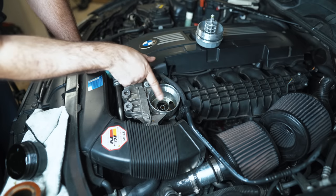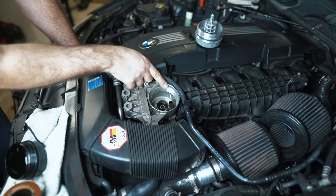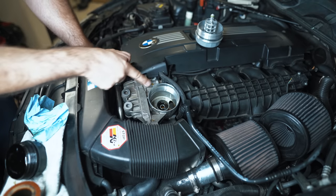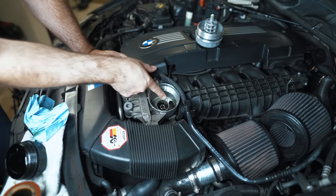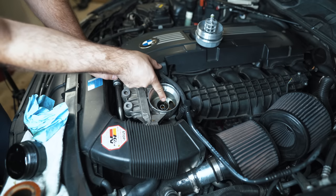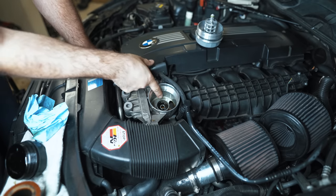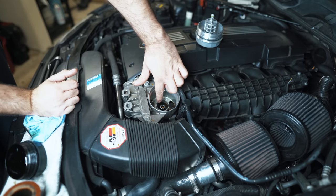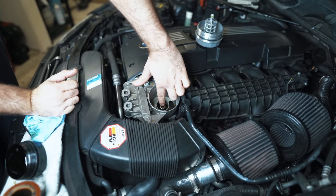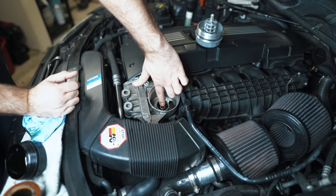If you don't have the cage, you lose the pressure relief, so you can overpressurize your filter at times. But that's not super likely depending on the clearances of your engine. I think it's a volume issue more than anything, because the oil filter housing has a small hole to allow the housing to drain when you pull the filter out, and the hole for feeding the engine with vital fluid is maybe three times as big. So you're losing about 30% of your flow at all times as oil is pressurized through both holes simultaneously. That's hard on the engine. It's not going to cause it to blow up unless you're at high RPMs at the track, but it will cause a ton of issues and excess wear over time.